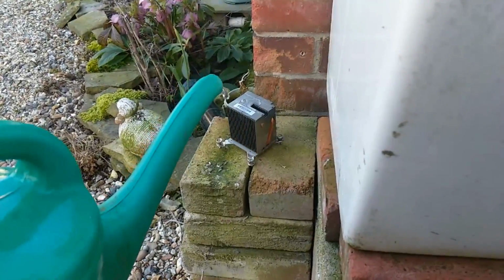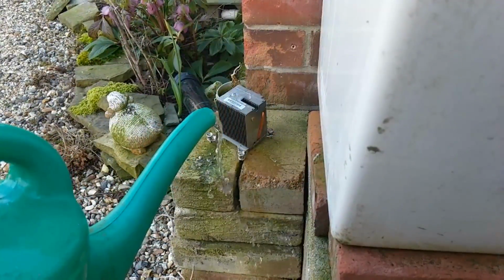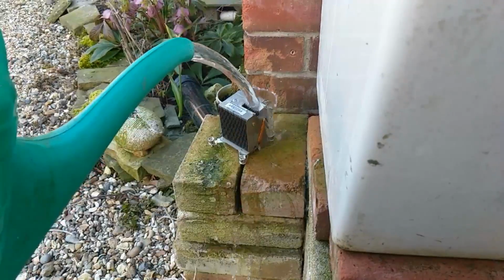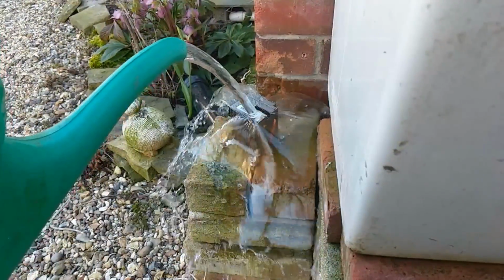You should pretty much expect to clean out any of these things as they're generally pretty old, so they do have 5 to 6 years' worth of dust inside, and they just need 10 minutes of cleaning and some new thermal paste to get them properly tidy. Feel free to take a scrubbing brush to any of those dirt-filled heat sinks, but mostly just grab yourself a brush and get it all over with at once.